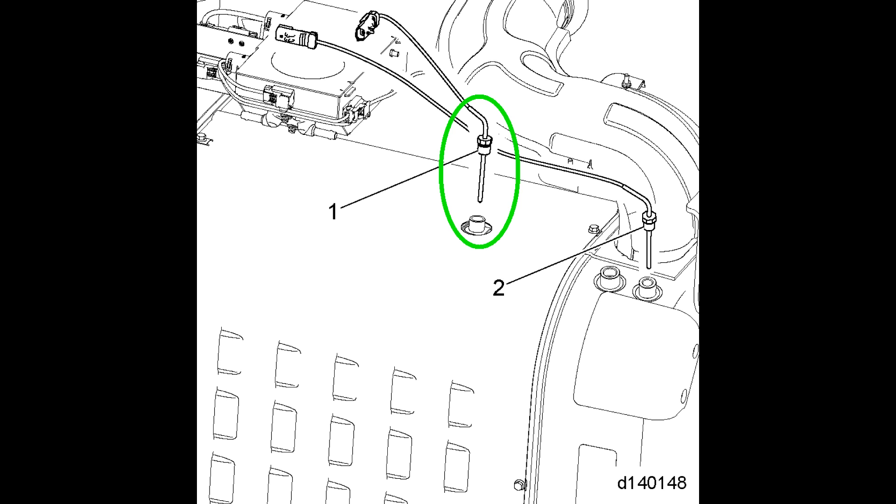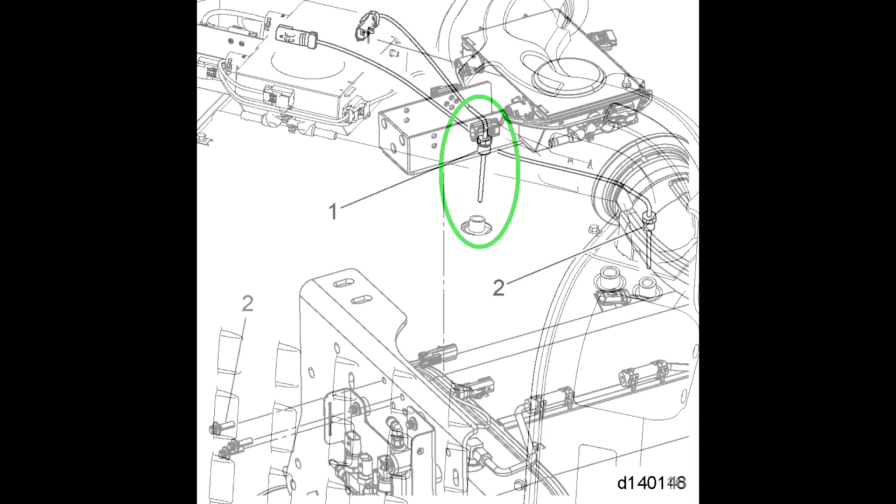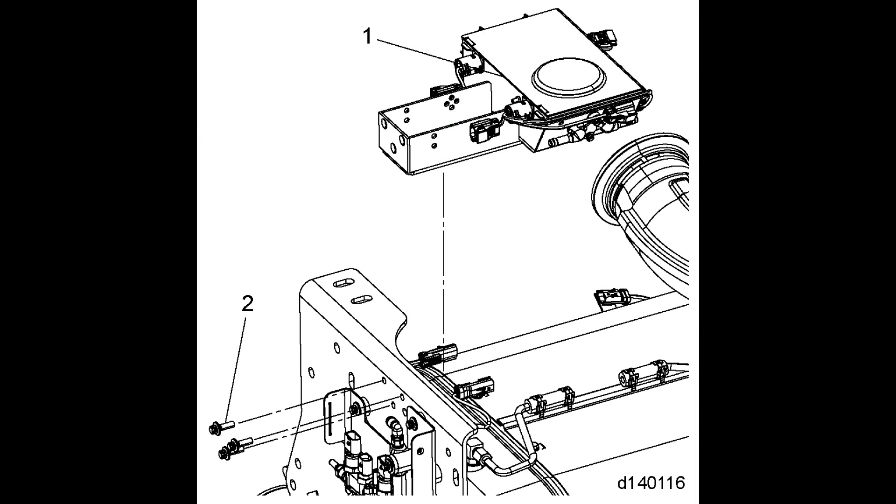On this generation 1 box, the biggest thing you'll have to remove is the sensor box from the top. To do this you'll need to disconnect almost all the temperature sensors and also the DPF outlet pressure tube. The sensor box is attached to the 1 box with 3 bolts — this is another item you'll have to watch out for because they have been known to break.